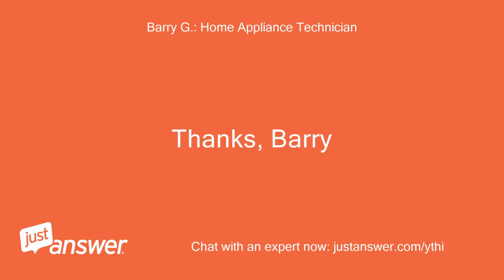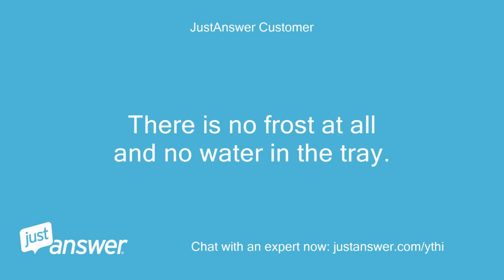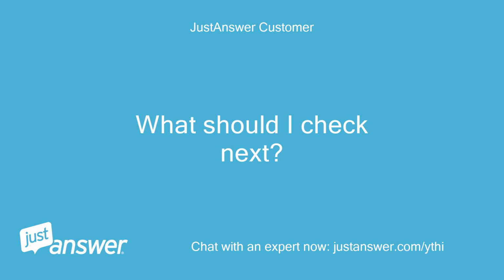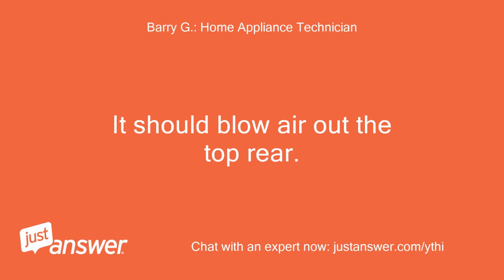Thanks, Barry. Hi Barry, thanks for responding. There is no frost at all and no water in the tray. What should I check next? Turn it back on and check to see if the freezer fan comes on. It should blow air out the top rear.